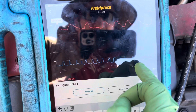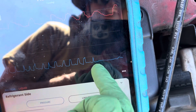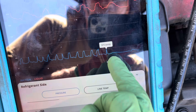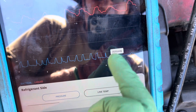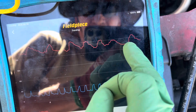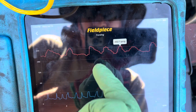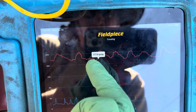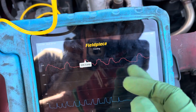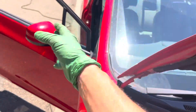You can see the cycle time is extending. You can tell right when I opened the doors and windows and put it on fresh air mode — because now it stays on longer: 18, 20, 19, 20. The high side still only goes up to 209 psi, 202, 206. So 209 to 206.